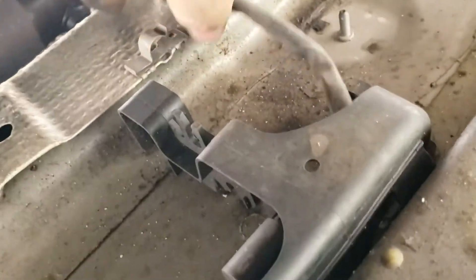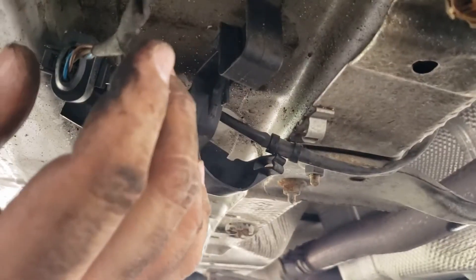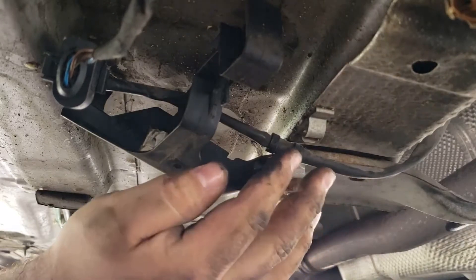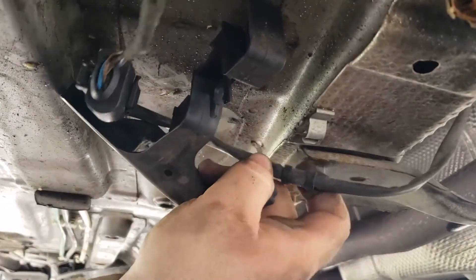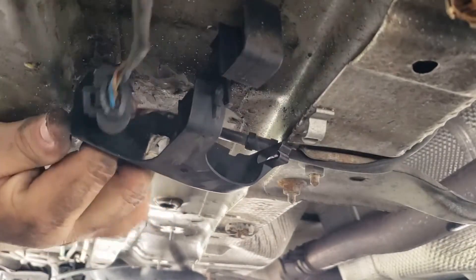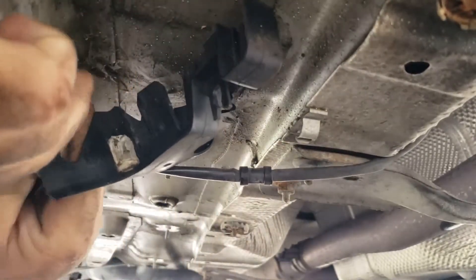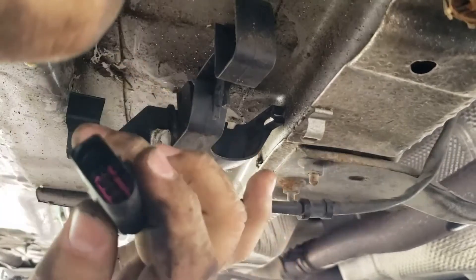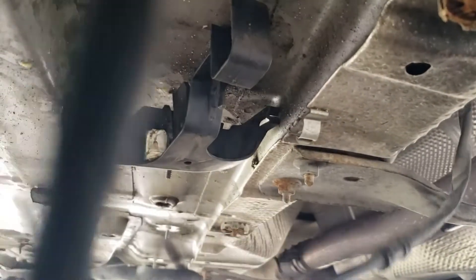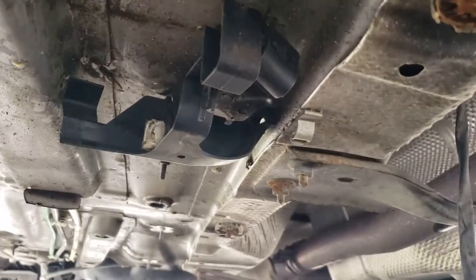Here is the connection for your O2 sensor. You can snip this off if you want — here's a better shot. The oxygen sensor wire cable goes into this plastic retainer which you're going to have to mess around with. To remove this connector, simply push the tab in with your thumb and pull the connector out — very simple. Don't snip the wrong side off — that would be embarrassing.